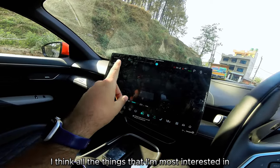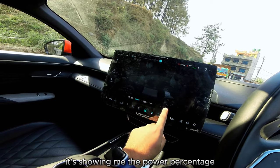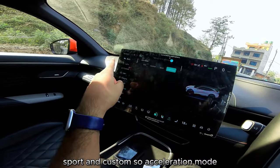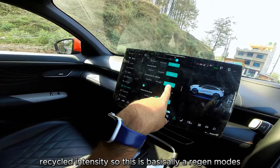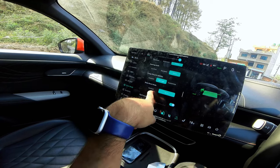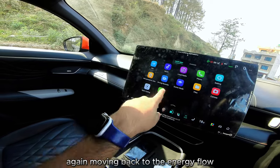Back to the menu screen — the most interesting feature shows 62% battery and approximately 250 km range. It shows power usage percentage in drive mode. Drive modes can be customized: eco, sport, comfort, and custom. Acceleration mode, steering mode, and energy recycle intensity — essentially your regen modes — can all be adjusted, though they're buried in the menu. Brake boost mode in comfort and sport, and hill descent control, can also be toggled.